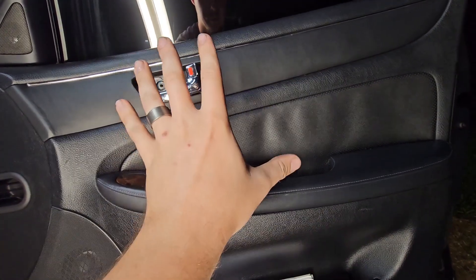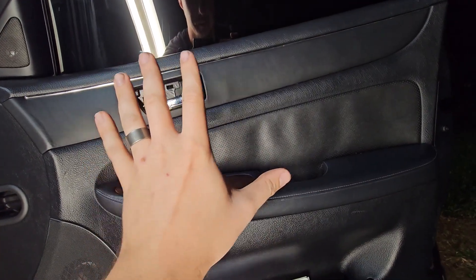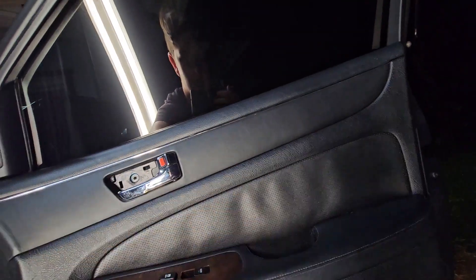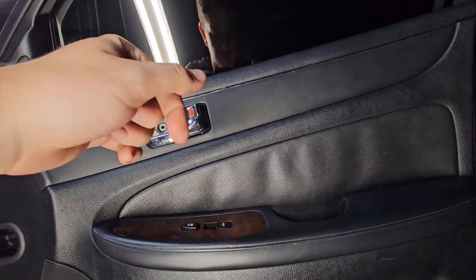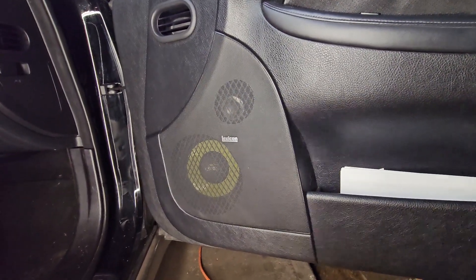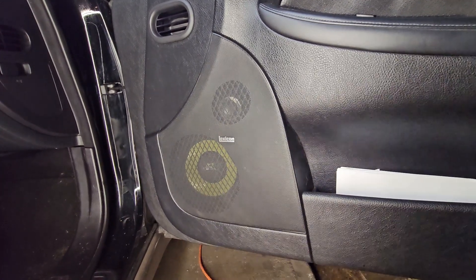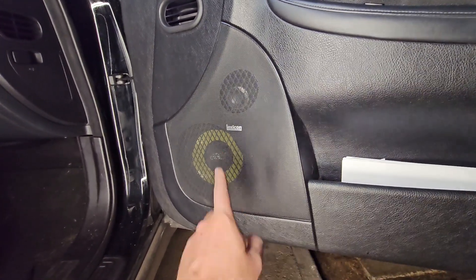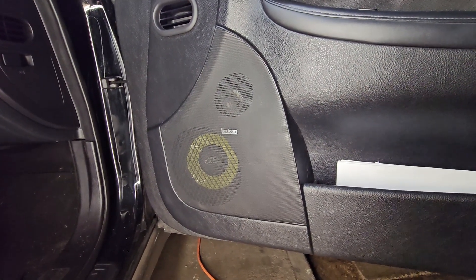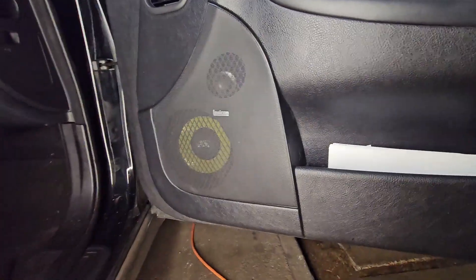Then you basically pull the door panel up at an angle towards the inside of the car. Pull the right side up higher, then slide it over to the right and off the track. If you see that little weather strip piece come off, I have other videos on how to fix that - check the link in the description. Also if you noticed I have different aftermarket subs in my car and you're curious about replacing your subs, I also have a link in the description. And if you want a more detailed explanation about removing the door panel, I have a video on that linked below as well.